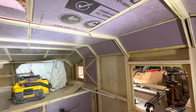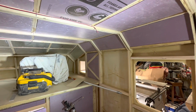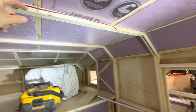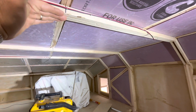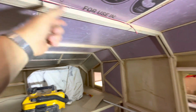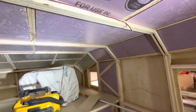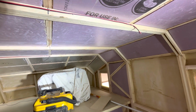So we've got 2 inches of XPS. We'll have 2 inches of EPS for a cosmetic surface. It'll be wrapped in fabric, like I've done on most of my campers. And then because this portion here will be a little bit wider down, when the EPS is in there, it will be flush across here. And then there will be a trim piece that goes across, which is going to help. The glue should be enough to hold everything together, but that little trim piece will form a decorative edge across the seam. It'll be a mechanical way of holding everything up.